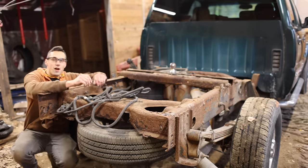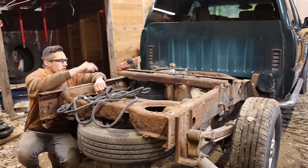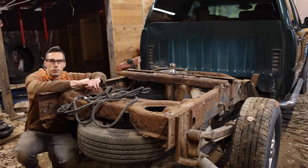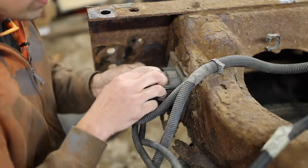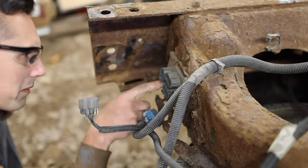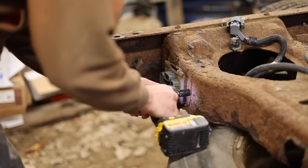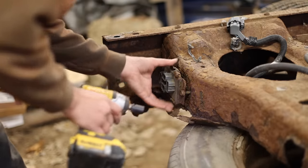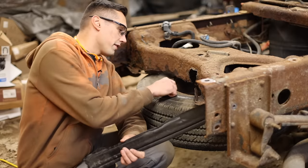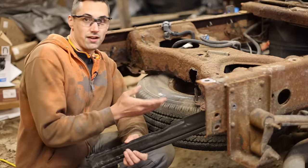So with the truck here in the shop, it's now time to start removing things from the rear end. I have to remove the spare tire, the fuel tank, the gooseneck hitch, wiring, stuff like that — get it out of here so that I can start removing rust. When I go to reassemble this, it says gray, black, and blue on the connectors, so I don't actually have to remember anything. I found the tool to lower the spare tire. The date code on the spare tire says it's from the 16th week of 2005, so this is also the original spare tire for the vehicle.